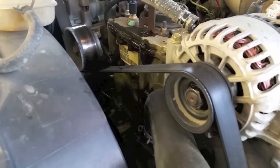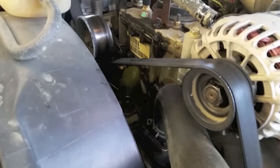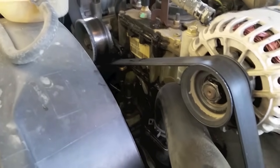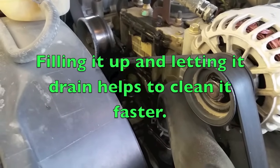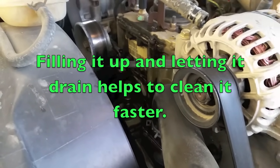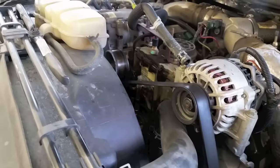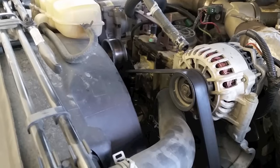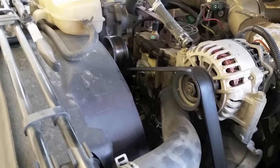Pull the heater hose off and let it drain. I'm going to run fresh water through it — with it running, with it off — shut the engine off, shut the water off, let it drain down, let it fill back up. That way we try to get the water traveling everywhere we can. With the engine running it'll travel in certain directions; with it off it'll go in other directions. We're going to force it back through the heater hose — all types of different areas trying to get all this out. I've drained it and I still have the drain out so I have the fastest flow possible.